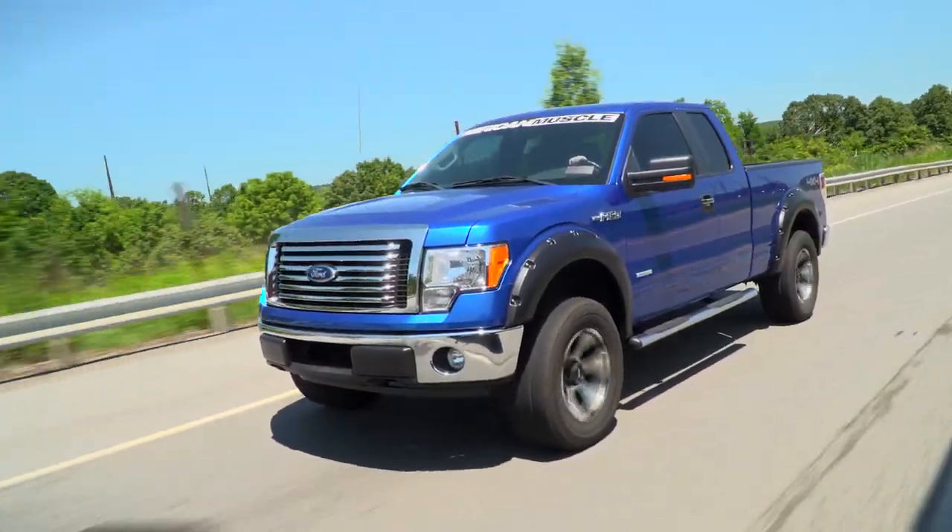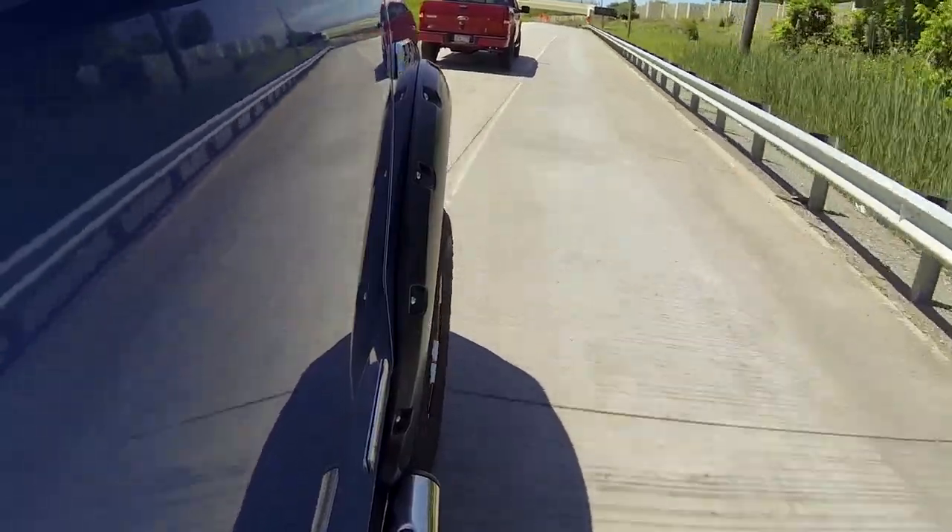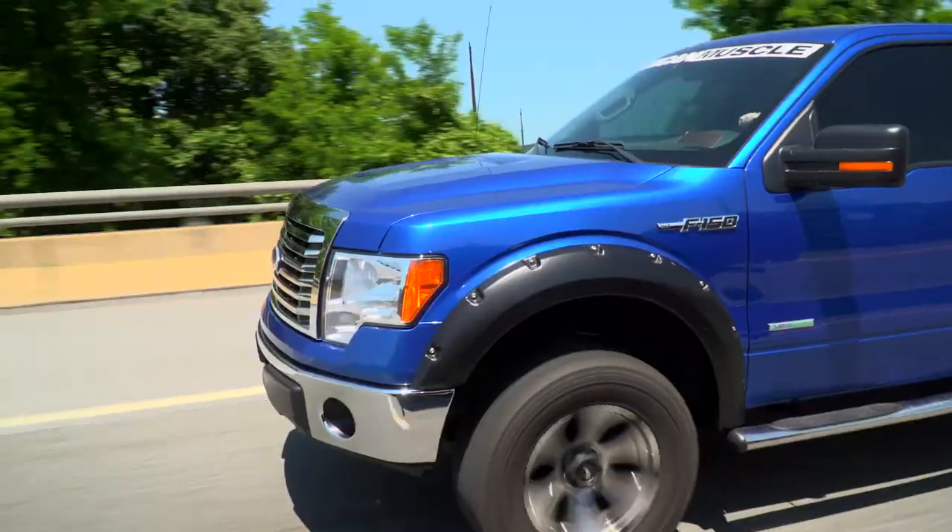What I really haven't talked about too much yet is the different transmission settings — I'll talk more about that back at the shop. MPT doesn't stop with their engine calibrations; they give you a ton of options with their trans stuff. This is the stuff that takes a lot of time. A lot of people can just throw boost at a truck and maybe a little more ignition timing and make big power numbers, but to really fine-tune the transmission tables, settings, shift points, firmness, and torque reduction — there's a lot of science that goes into this. MPT has definitely done their homework, and this is what really separates their stuff from the more canned options.